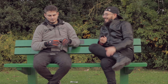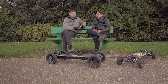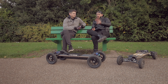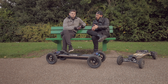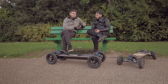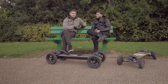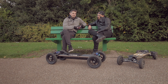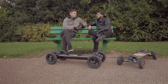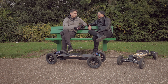When we talk about the controller, there's no information on what it is. I have a VESC skateboard at home — the Bound Motor M3 — I know how a VESC experience feels. I know how Hobbywing feels, which is what I've tried the most. What they've done is picked an extremely popular Chinese controller — most probably the Kelly controller. Back in the day before Hobbywing and VESC, the Kelly controller was pumping out serious power. But nowadays you have the Stormcore doing 18S and Trampa single-channel VESCs doing 20S — those completely outclass these controllers in my opinion. I expressed this to Bajaboard and they didn't reply.